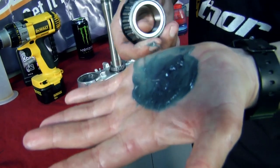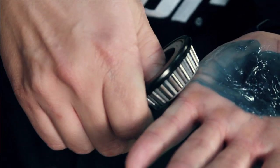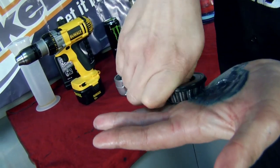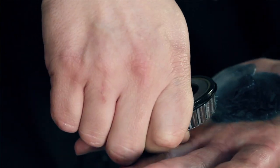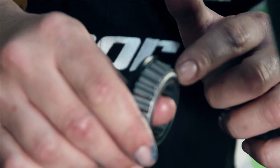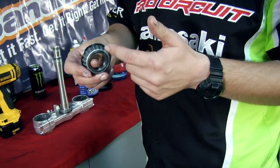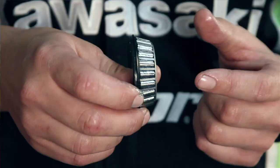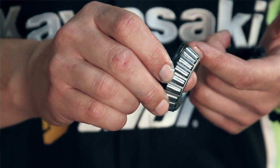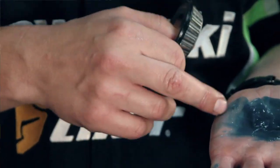Turn the bearing down and try to get the edge of the bearing onto the bit of grease, then force it down inside the bearing. This takes quite a while — just kind of brush it off your hand. You'll notice you'll have a clean portion of your hand where the grease used to be, and you'll start noticing it gets through the bottom. Repeat that process all the way around the bearing until it's completely full. Spend some extra time making sure there's a lot of grease coming out of the bottom, because the rider is going to feel it on the bike. If the headset doesn't have enough grease, it's going to feel notchy and not smooth, so take your time and get a lot of grease inside the bearing.